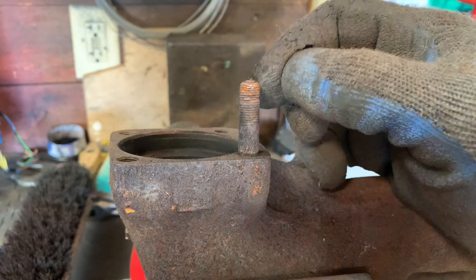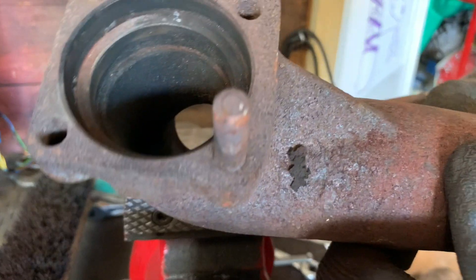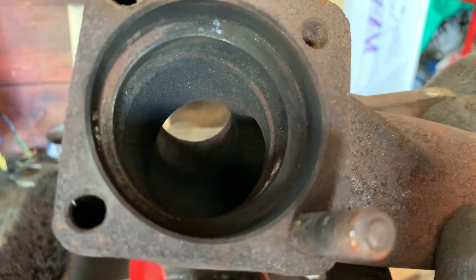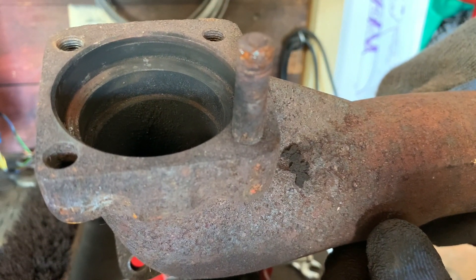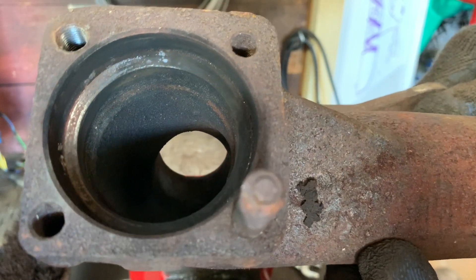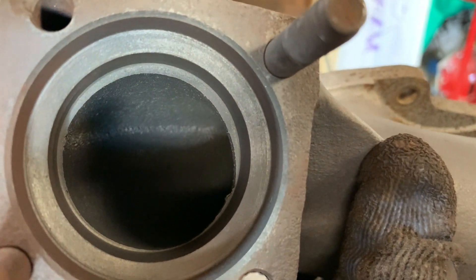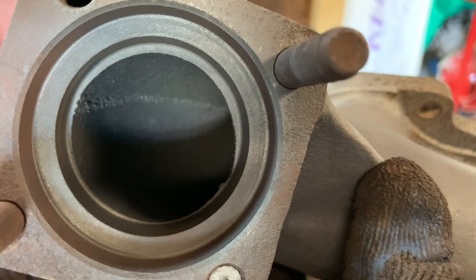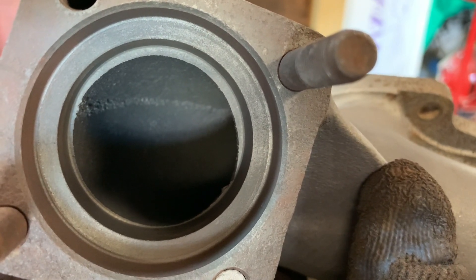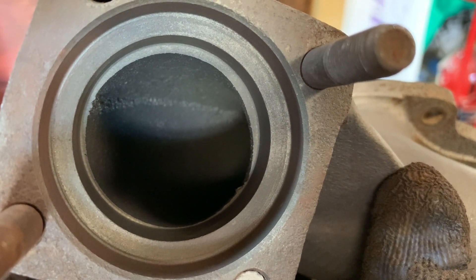As I mentioned, this area right here — it looks like this has been sealing pretty well, though there's some gray around the outside, so it may have been leaking. It's important that you get this clean before you put the new seal in. What I do is actually sandblast the inside of it, and if there's any question about pitting, you're going to put some exhaust sealer in there — unless you've got access to another manifold, which I do, but don't need in this case.